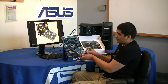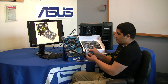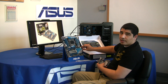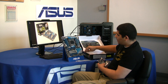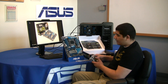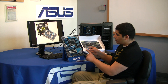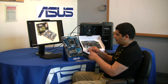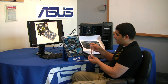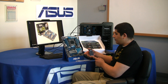We've got six SATA cables — two in each pack, giving a total of six, with four of these being SATA 6G connections. The PCH has six ports just like on Z68 or P67, with two of them being SATA 6G, and our ASUS SSD caching ports are also SATA 6G, so we're giving you four cables for those four SATA 6G ports. We've got our Q-Connector — one for the power leads and one for the USB port — as well as an extended blank SLI bridge, and because this board supports three-way SLI, a hard three-way SLI bridge.